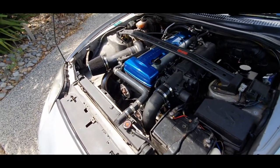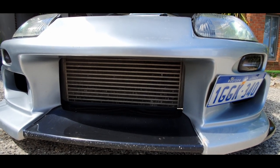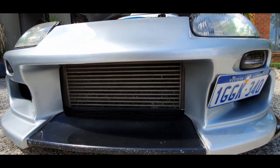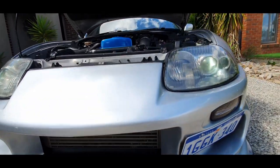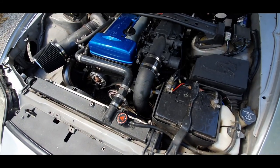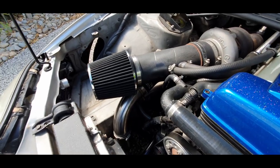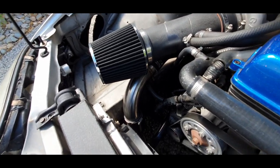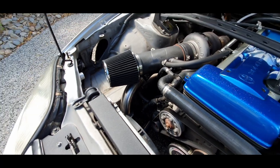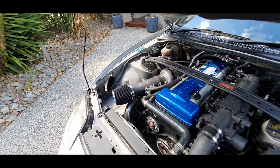We have our front mount intercooler — China spec. I haven't got 1,000 horsepower and I'm not aiming for it, so this has been amazing for the whole build. The cold side pipes came with the kit, whereas the hot side are custom — I built them myself. I got a bunch of different pipes and connected them, and I'll be getting that made into one pipe soon. I just wanted to make sure the route I was taking would work, and it has worked really, really well.